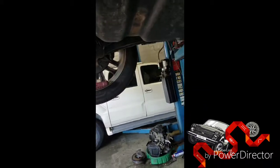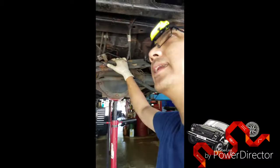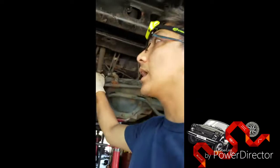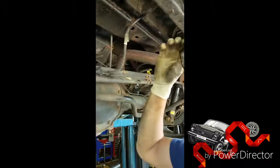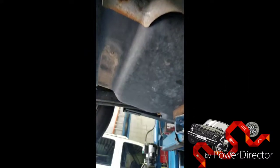It's a little tedious because I had to drop the tank a little just to see where it's coming from, but that's my everyday work. Hopefully this helps you out. This has a code P0442, and the description is EVAP emission small leak. If it's not the gas cap, then it's this or the solenoid — the purge solenoid in front of the engine. By the way, this is your canister. I had to check all those hose connections too to see if they're leaking, but on this one it's not that. So I'm going to call it the fuel pump — replace it — and hopefully that's all it is.